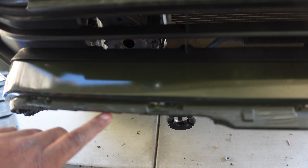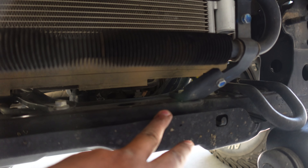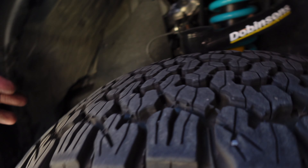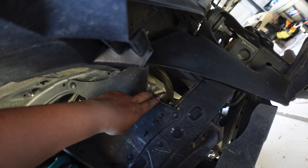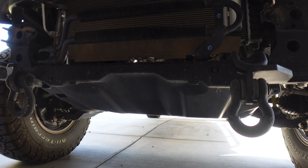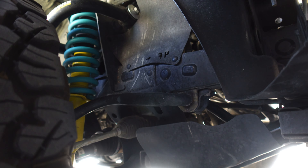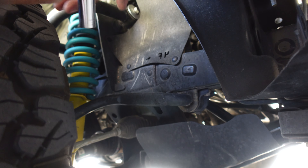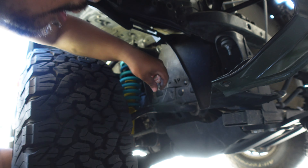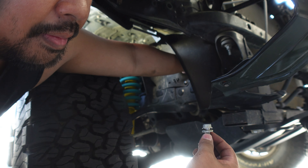Once you've gone ahead and cleaned up your cuts with the file, it's time to go underneath the truck and relocate the power steering cooler. To relocate it, there are three bolts — one here, one here, and then one behind here. The two front bolts are 12mm and they're on there pretty tight, so you might have to use a breaker bar. There's one bolt in the back you need to take out, but you're going to need to use it later after you push everything back.